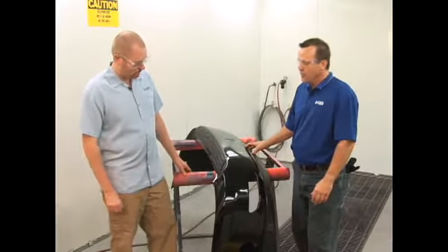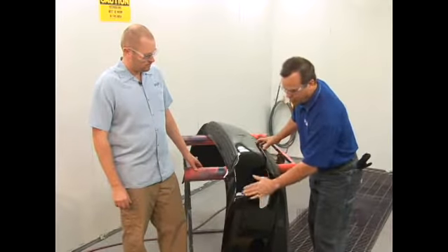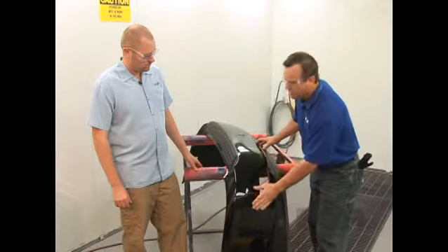What's our next step going to be? There are some minor imperfections remaining, so the next step will be to prepare this for the plastic repair fillers. We're going to sand this down, and as we do, we'll address some of these very small areas by block sanding some of them away. When we apply our filler, we'll smooth out some of the very minor imperfections.